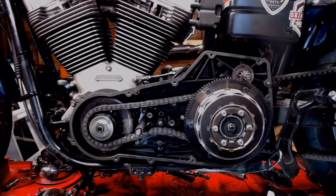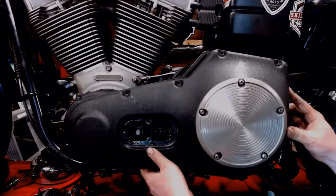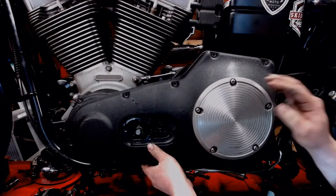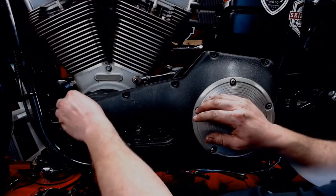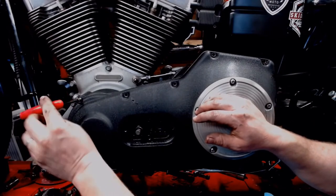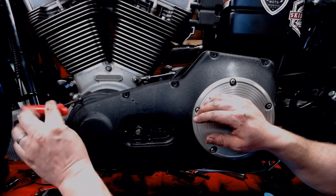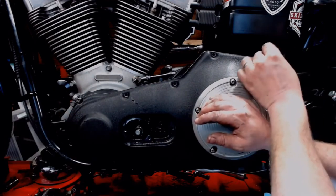All right, have a primary gasket hung up on there. Got our primary cover here. Everything's all cleaned off, we're ready to go. So we're gonna pop this sucker right up on there, on the studs. Got a couple bolts at the ready here, and a T-handle Allen wrench. So, not gonna tighten anything down. Just get the bolts started, enough to keep the gasket lined up, keep the cover hanging in place.